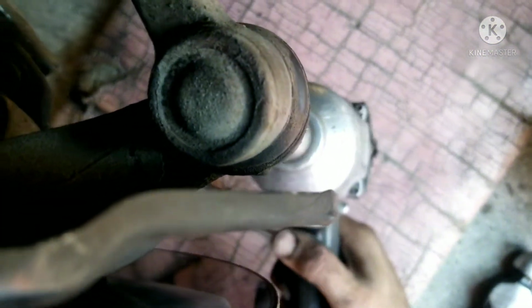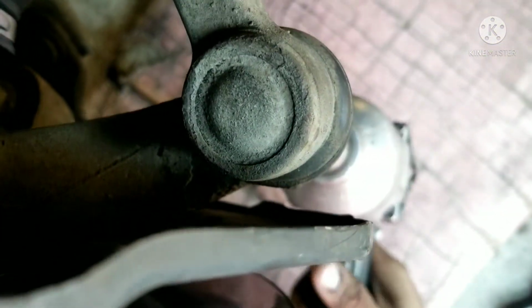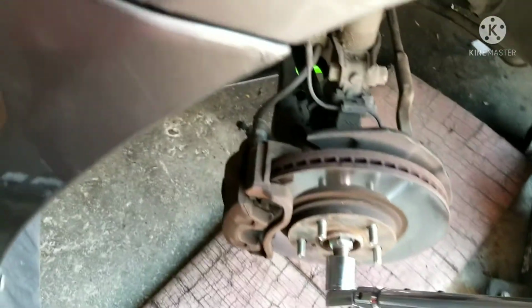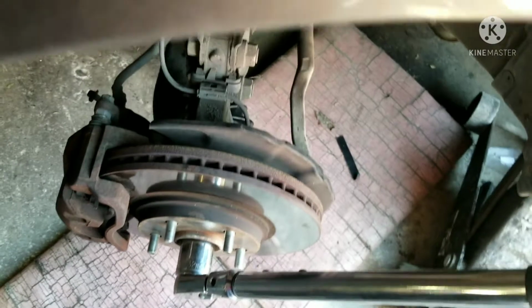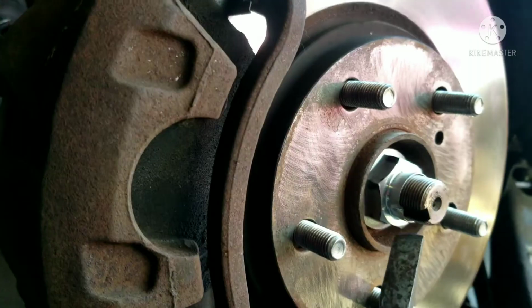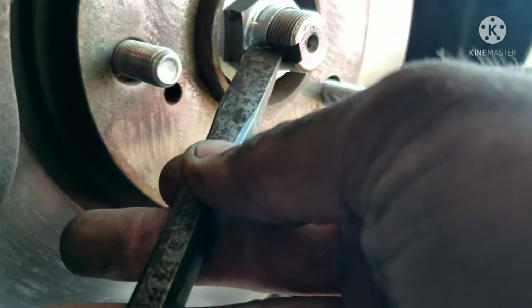It's pretty simple. On this, you want to make sure that you get the nut to a good spot where you can get a cotter key through there. And you want to make sure that you torque your axle nut, because there's a certain preload that you have to have for your wheel bearing in order for it to stay together. And here's where I put my cotter key through there. You always want to make sure you do cotter keys, and you gotta dimple this to make sure the nut doesn't move.